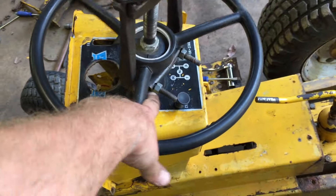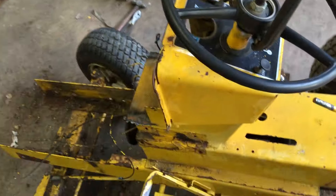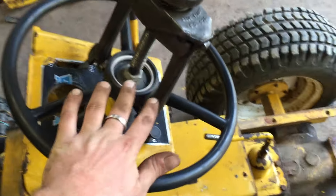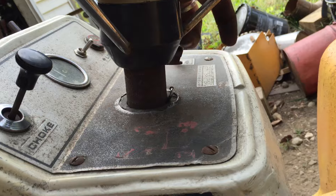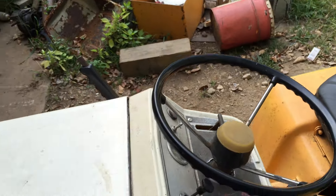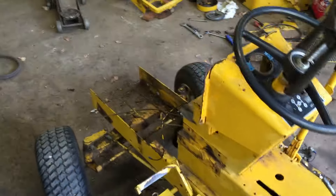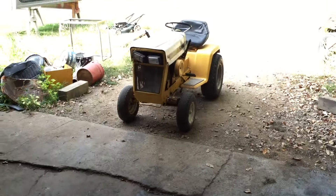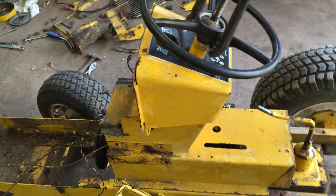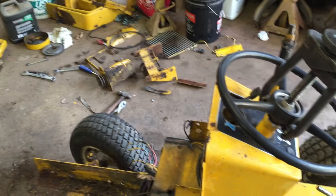I've got my muffler clamp down here — it's a little modified. I welded on these nuts. I know you guys have probably seen this in all my other videos, but there are still a lot of people who have a problem taking these off. These wheels are actually really easy to take off. It's this style that's a little bit harder because it's got this taper on the bottom — you've got to be careful because you will mess that up trying to take it off. That's the only style that has the problem. This one is pretty flat on the bottom; it's really easy to take off. The 82 series are pretty easy, even the quiet lines are pretty easy, but it's just that style with that kind of steering wheel that's a problem. It still does work — you might have a little bit of damage when you get the wheel off, but it still works good and you could clean it up after.